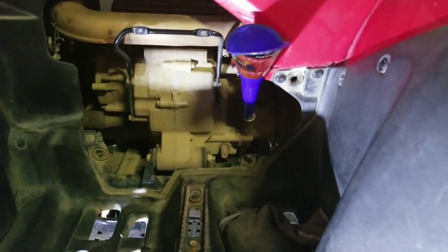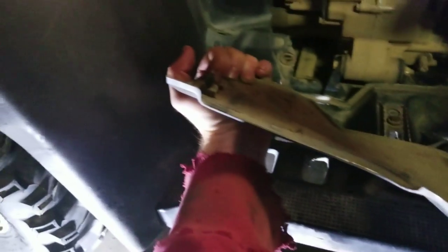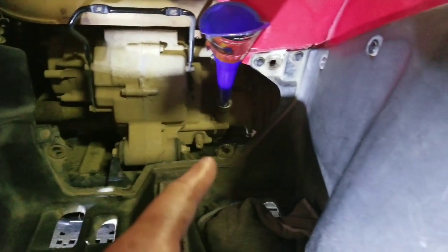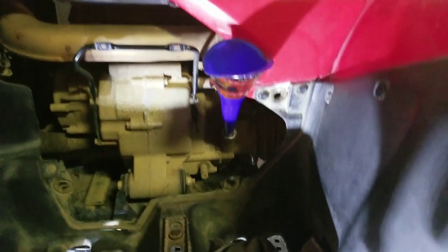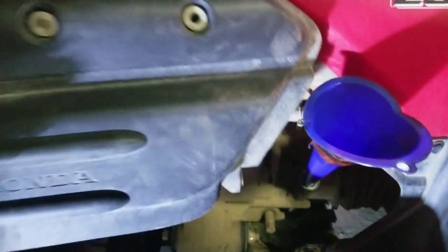All right, so the oil filter has been changed. The oil has been drained out. And now we are here to fill it up. If you're not real familiar with these quads, it's actually kind of hard to find. This cover here actually blocks the fill, if you can kind of see it like that. And you just pop them off. They just have little tabs, three of them, 1, 2, 3 right there. So you just pull that off, and that's where the oil fill, the dipstick is. And you don't have to take this one off up here. It covers like so.